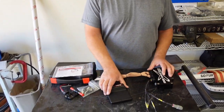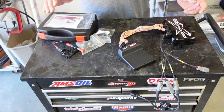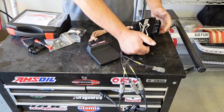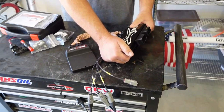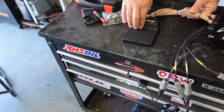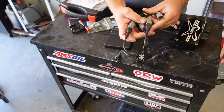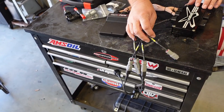So this is the stuff — this is the MoTEC, and this is their M130 series. There's other brands out there — Emtron, different ones — but I don't have experience with those. This would be a box that replaces your factory ECU. This is your CAN bus harness. You take out your factory ECU, plug your existing harnesses into here. This is more or less an adapter box that goes into your new ECU. It helps things communicate — you've got your igniters, your O2 sensor, belt temp, all sorts of things you can control, because you have basically an unlocked, open ECU.